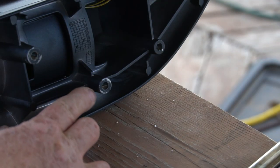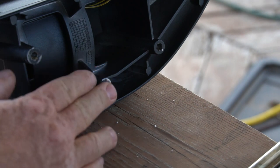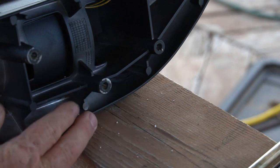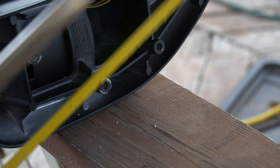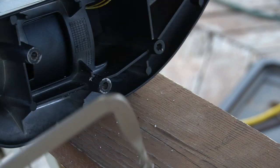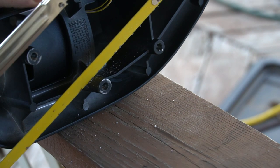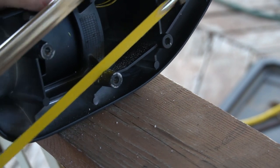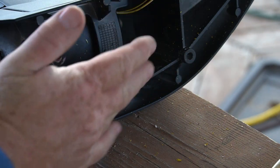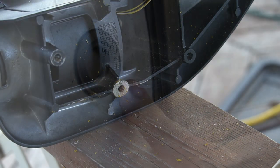There is a bolt that's right in line with this stud, so we can't drill through the door there. There's a bolt on the opposite side and also a horizontal plate inside the door, so this one's got to be cut off. We don't need it — we still have three bolts and the original only had three. I'm just going to trim this out of the way because it's just a problem. I've got it cut off and now we don't have to worry about that pushing into the door or that screw or that plate.